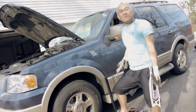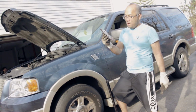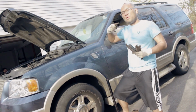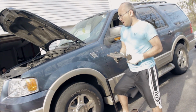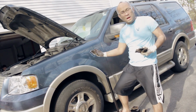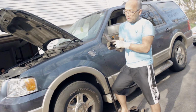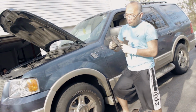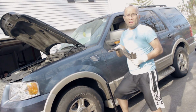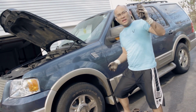The front brake jobs. As you can see, the brake pad is totally gone for this one in a way, and that's the reason why we changed the brake pads. You can actually hear the squeaks when you're driving, so that's how we know. And you cannot really check the inside of the brake pad or the rotors, the inside surface. You can see it because this was the inside one. It's totally gone to the metal, and because it's gone to the metal, it's scraping against the rotor and it's destroyed the rotor as well. So we have to change both sides, left and right, the brake pads and the rotors. So thanks for watching.